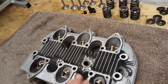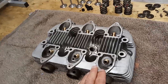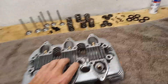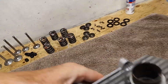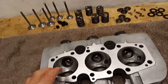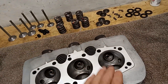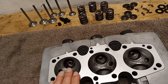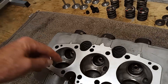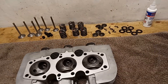I generally do fit the seals to the exhausts and I haven't had a problem with my bikes. I'm not saying which is right or wrong, but that's what I'm going to do. One other thing: the engineer cut all the valves and said I don't need to grind them in. Normally you'd use grinding paste to grind the valve in, but he's cut them and they're perfect - so I can just fit the valves straight. That's wonderful news.